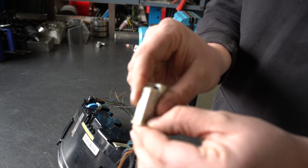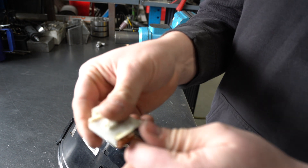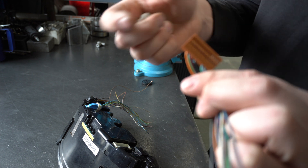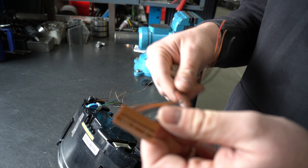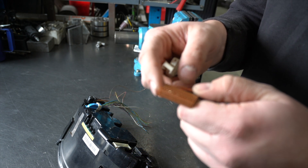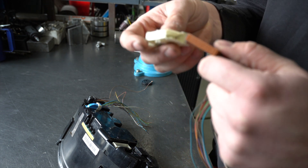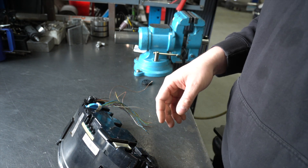It's super easy to do. Essentially all you got to do is pop this little clip out — there, one came out, it just slides out like that. If you have AllData or a pinout diagram, it shows you everything you need on these. So I'm going to reopen those diagrams that I have on my phone and figure out exactly what I need to power this and send signal. I know this black wire is for the tach, so get that all sorted and we'll go from there.